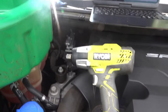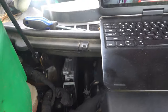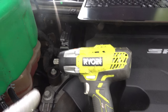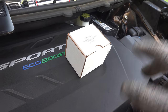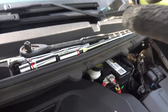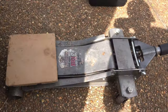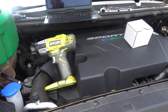To tackle this project we're going to need one of these catchers, then a Torx bit — I believe it's a T15 — to take that off. Then we'll need a 22 millimeter on our impact, and the other side is 15 millimeters. We're going to need our thermostat obviously — it's a 160 opening temperature, and it's about 58 to 60 dollars. We'll also need ratchets, a jack, a wooden block, some standard fair tools, and obviously patience. We start from the bottom.